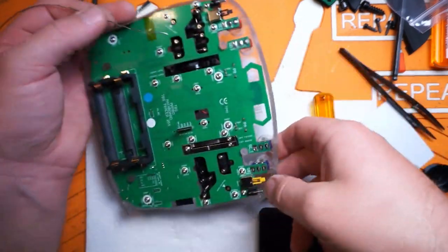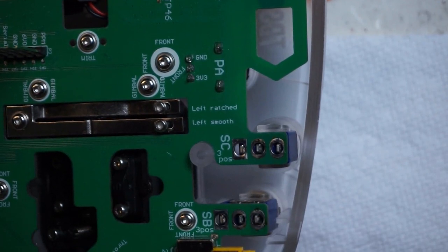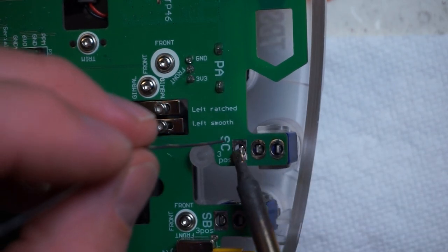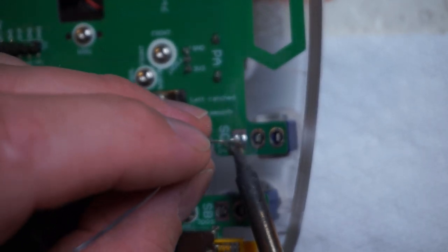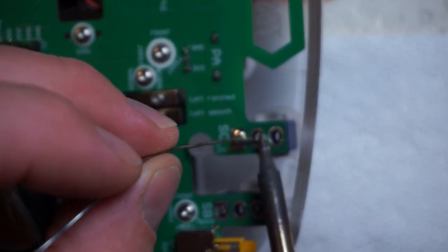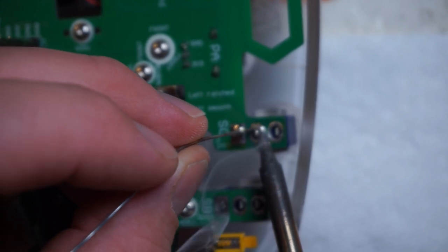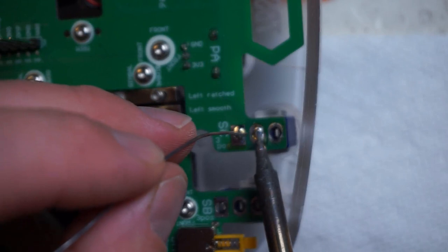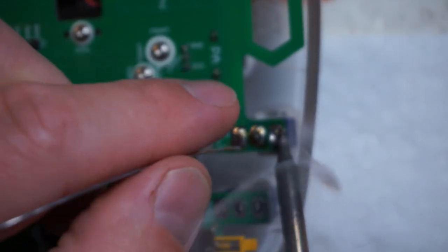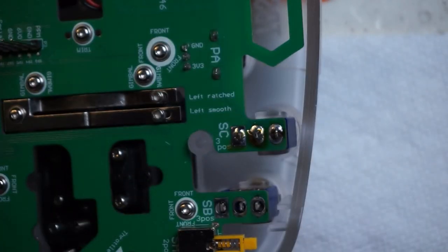Get our switches oriented properly. You've got to be really careful around the gimbals when you push these down - you'll end up breaking the little rings out and it's really annoying. They don't line up super well, so you need a little bit of support while you push them in. I'm going to just loosen up the gimbals just a smidge to help them align themselves, gives them a little bit of room to float around. Very carefully work your way around it. That's in - we'll get our screws in to secure the front.